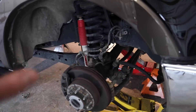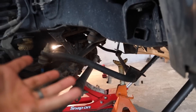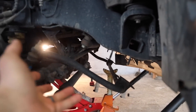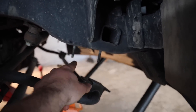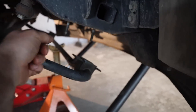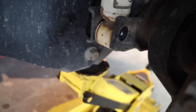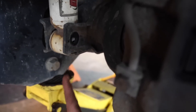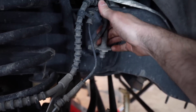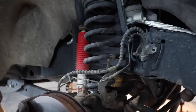I get some questions on how hard this is to install, so I'll give you a quick walkthrough. The directions are actually very good with this ReadyLift kit — it gives you a step-by-step. First things first: drop the sway bar off of the frame mounts and lower it down. Then come in and disconnect your lower shock mounts. After that, do your brake line so you can lower the axle — you're not going to break anything. The brake line bracket bolts to the frame right there.